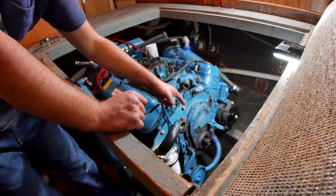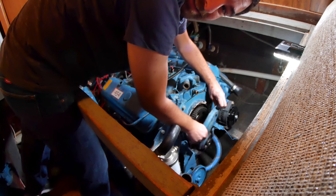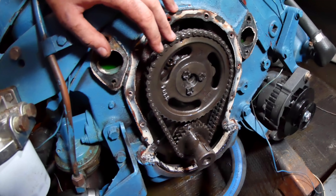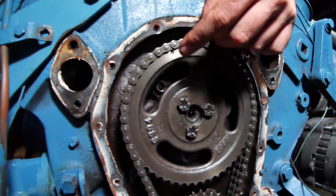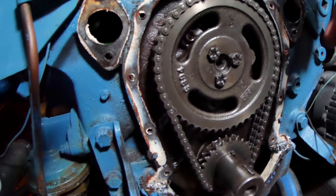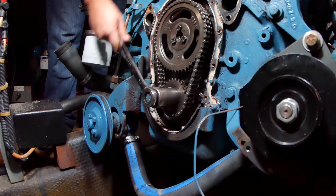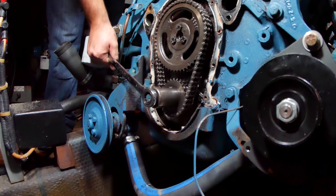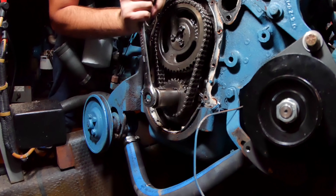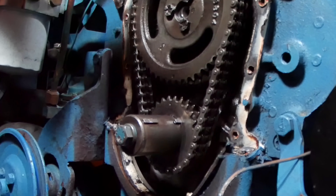There's the last sneaky bolt. Let's see if this cover is just going to pop off. And here it is — our very first look at the timing chain and gears. On these gears there are tiny little dots. I need to spin the entire motor until these markings line up. When I do that, they should be rotated to the correct point for reference. Almost there — I don't want to miss it. That's it. That dot and that dot are lined up perfectly.